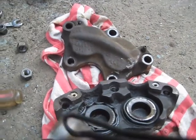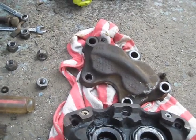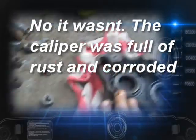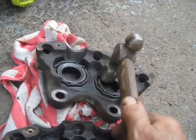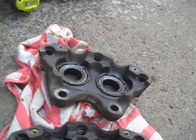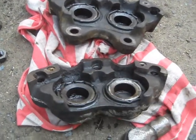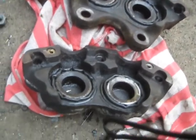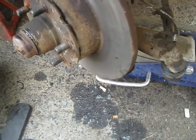I don't know if they'll even work. Looks like the pistons are loose, so they're probably alright. I'll just put these back together. I'm going to sand that a little bit so it makes good contact. Yeah, they're moving, so they probably don't leak. I don't see any evidence of old oil — maybe this one was leaking at some point. Can't really tell because I just cleaned it with gas. But I'll get a rebuild kit for these things. I'm just hoping I'll get some kind of brakes on it so I can at least move it around.